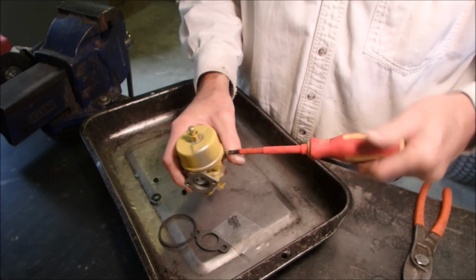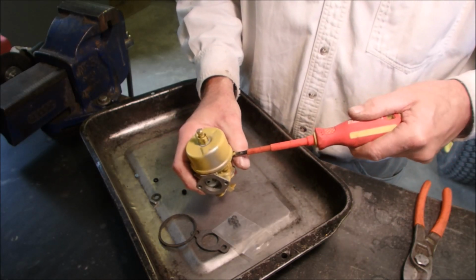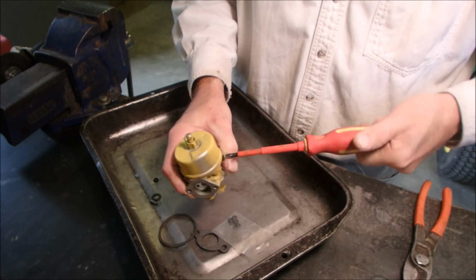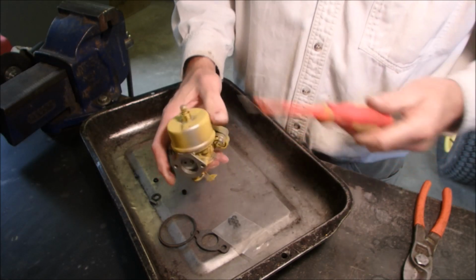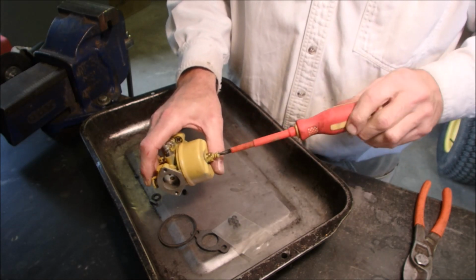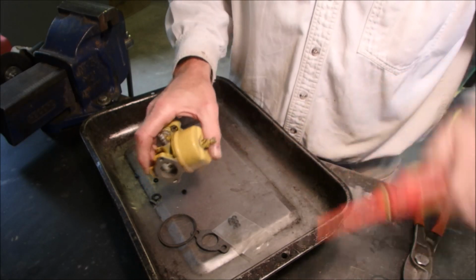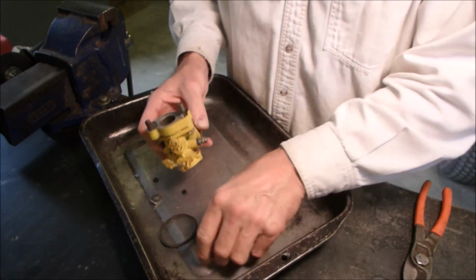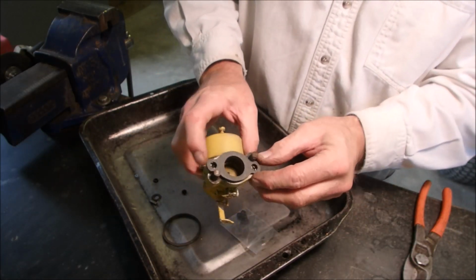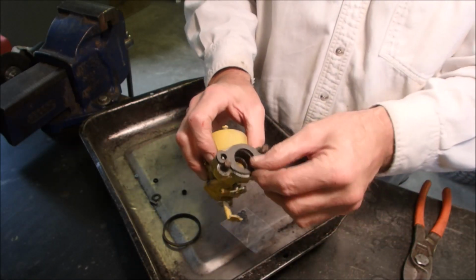And it was 3 turns out. It's almost like somebody was adjusting this to get some more fuel. Half one, and then this one is 1.5 to start. So that's tight there. Half one, 1.5. And we've got a new washer for the intake because that's been damaged, so we'll scrape all this off before we stick it on. But I'm done for the day.